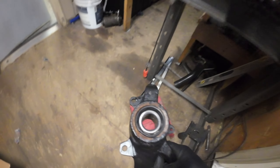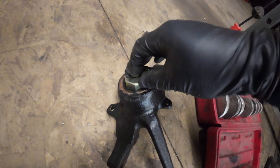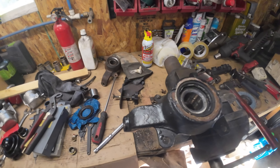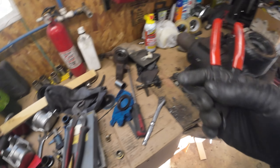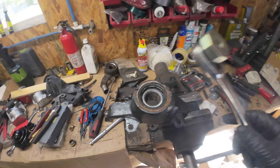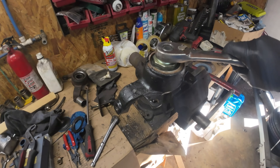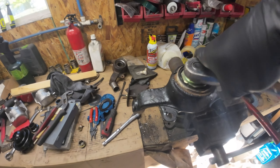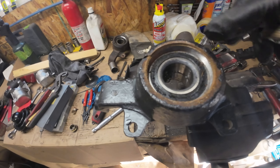The smell is horrible. Next thing to do: put this in the vice, get this special tool right here, place it like so, and get the half inch ratchet and screw it in. On normal cars you'll have just a regular snap ring and you grab your snap ring pliers and take that out. But this is not a normal car — this is a Yugo — so you have to have a special tool. Looking at this, the person that installed it before didn't have this special tool and didn't get it tight right; it's not supposed to come out this easy.